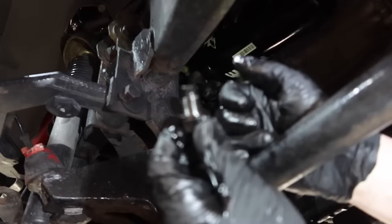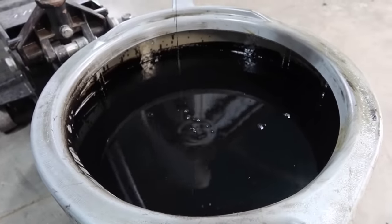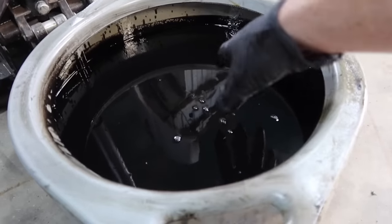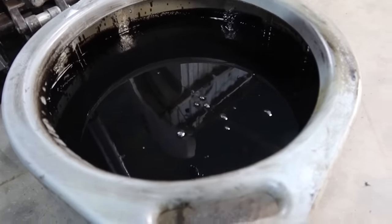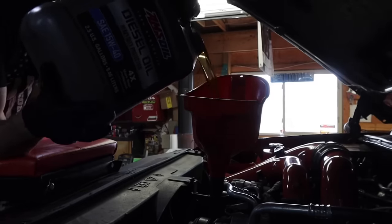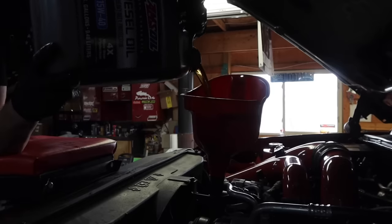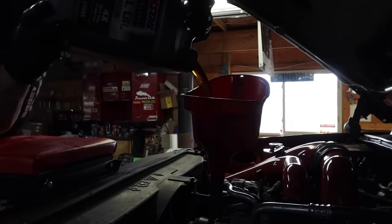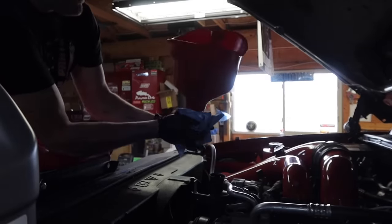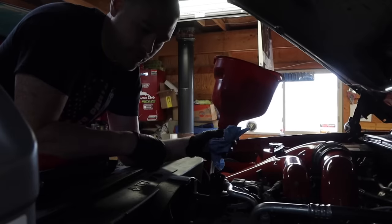Make sure you inspect your engine oil — it's always a good thing to do. What you're looking for is really thin oil; if it's really thin, it's possible that you could have fuel in the oil. You're also looking for metallic swirly or metal shavings. It's time to pour our Amsoil 15W-40 synthetic — again, it's not the end all; it's pretty expensive. I recommend something like Rotella if you're not using a high-capacity oil filter. If you're not, you're only going to use 10 quarts of oil. Let all the oil settle into the motor for a few minutes, pull the dipstick, make sure we're all topped off. We're good to go — let's move on to the fuel filter.